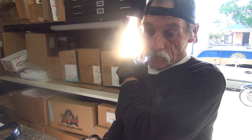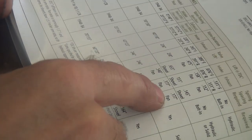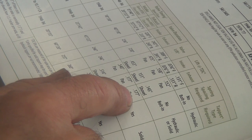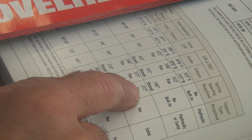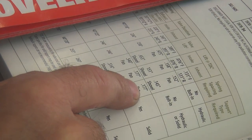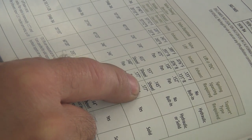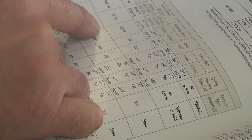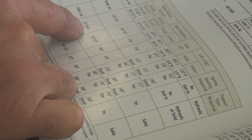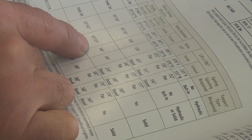Now, if you go with the 514 cam, it's 246 on both lobes, 177 duration. It's very similar to the Crane cam over here. You don't suppose they copied it when they bought them, do you? They would never say that, would they? 248, TD is 180. It's got more TD, that's better. Where's the opening and closing on this stupid thing? 2343, 1 degree different from this one? Yeah, this one's hotter. This is the one I want, though.